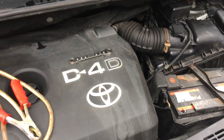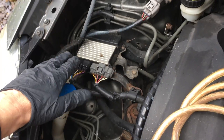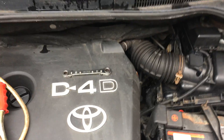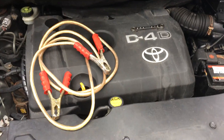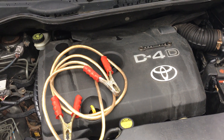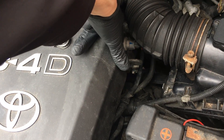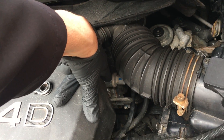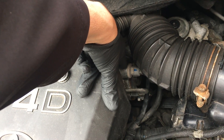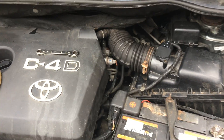Hello and welcome back to the channel. In today's video I'm going to be showing you how you can reset all of the ECUs on any car. So why would you want to do that? Well, over time the engine can pick up bad information through bad fuel and things like that, or if you've replaced sensors on the engine. I'm doing it because I have replaced the suction control valve on this engine, and apparently this needs to be coded or adapted to the engine, which I don't have the equipment to do — so that's the principal reason why I'll be doing it on this vehicle.